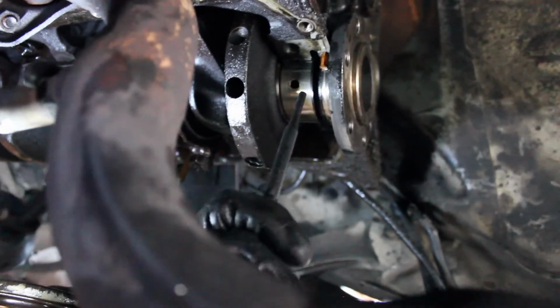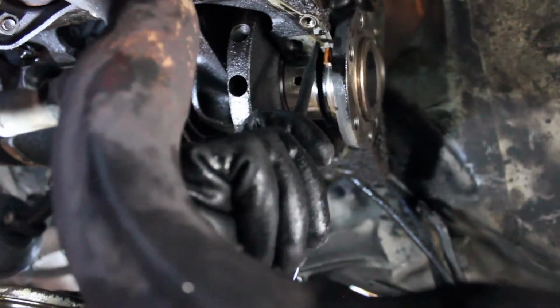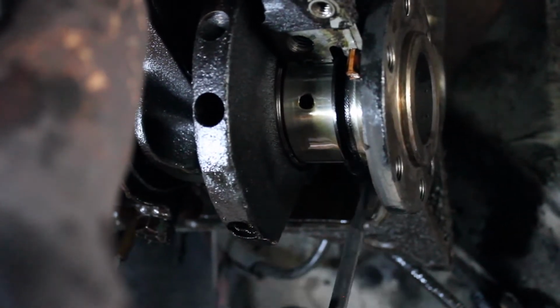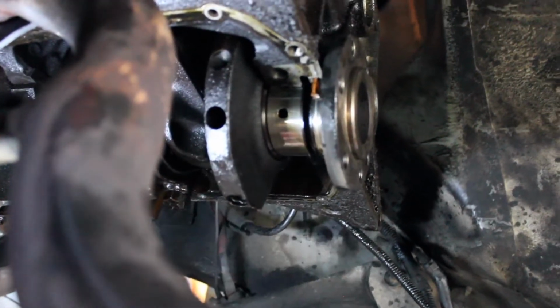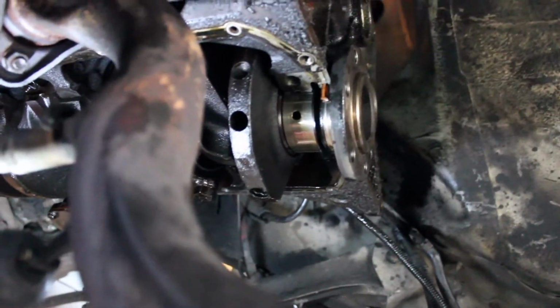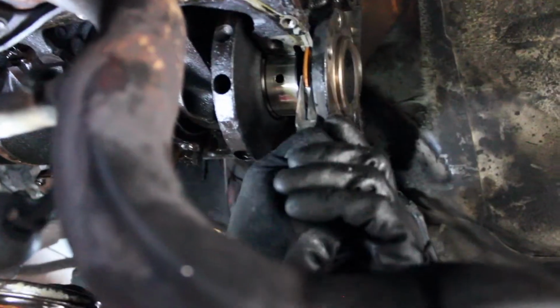Well, some good news and bad news. We'll talk about the bad news second. The good news, that's the rear main seal sticking out. It will be flush with the bottom of your engine. I went to the other side with this punch, and I just punched out the rear main seal, the top half of it, and it's gonna slide out. It's half moon shaped. Now I'm gonna grab it with some needle nose pliers, and I'm just going to work it the rest of the way out.